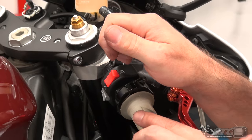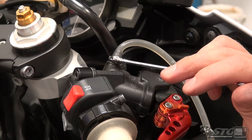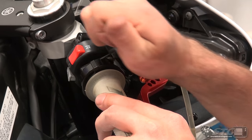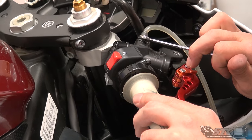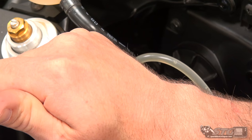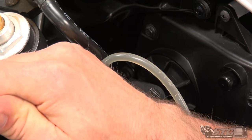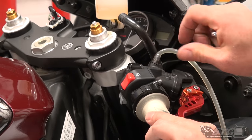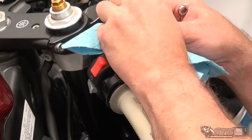What we're going to do is tighten the screw, loosen the lever. I'm going to open the screw, depress the lever, close the screw, release the lever. Open the screw, depress, tighten, release. I'm going to repeat this a few times until the bubbles are either eliminated or dramatically reduced. We are definitely starting to get a lever now. I'm going to pump it about three times, hold it, tighten it back down. Now we're ready to go down to the calipers and bleed those through.